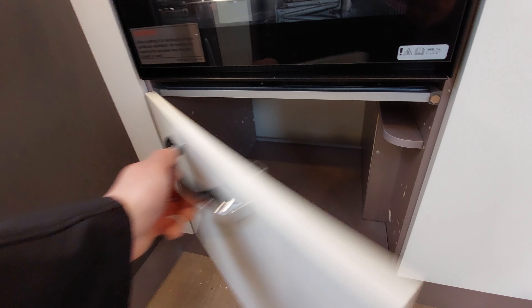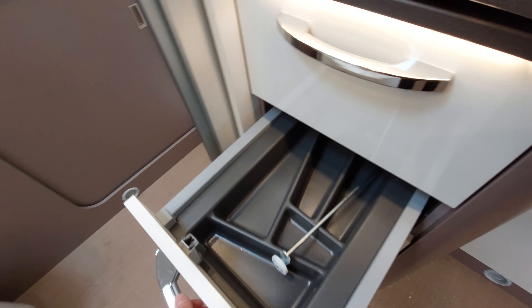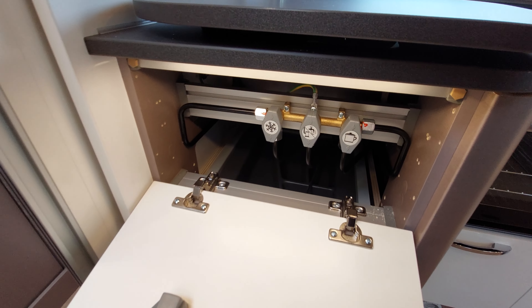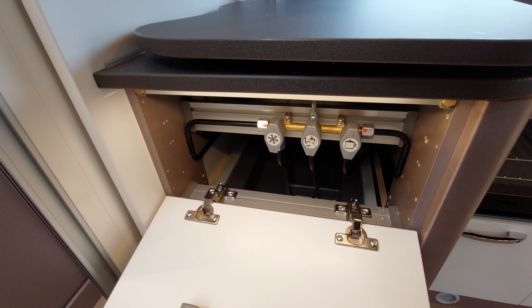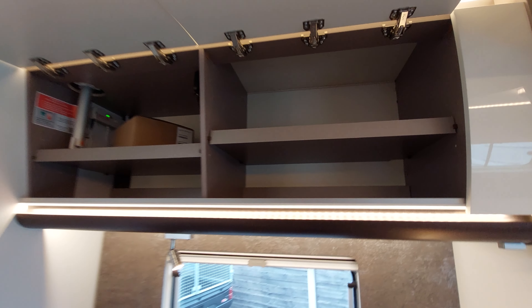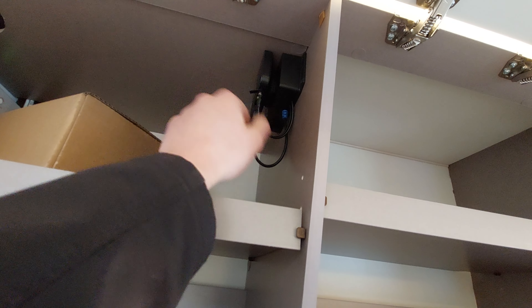On the end there's storage with your fitted sheets, the pigtail for the gas regulator, blue fluid, and the manual override rod in the cup drawer. Directly above, in the top cupboard, you've got isolator valves - these allow technicians to isolate areas of the vehicle, so I don't recommend turning these yourself. Above the kitchen area is more storage - this vehicle has had an aerial fitted along with a motorhome Wi-Fi system. Please bring a SIM card if you have this unit and I'll show you how to set it up on the day.